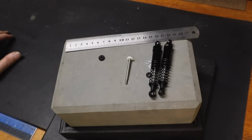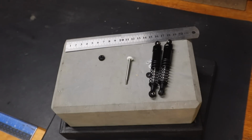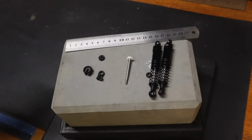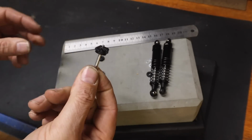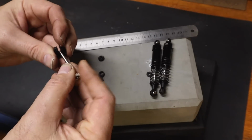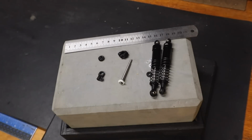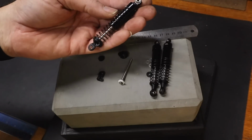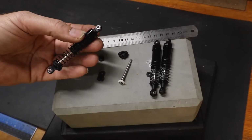So what I did is I took one of those pistons and I replaced that piston with it. And then I grabbed some Vanquish rod ends, because Vanquish, or Incision, however you like to view it, they'll actually fit. You don't have to machine them out. You just get it up right there. You thread your end on, and then these will lock on. And I do like a locking collar. And then I grabbed an Element Gray, because it was close on the bin. That is a 13 by 62 spring. And I did this.